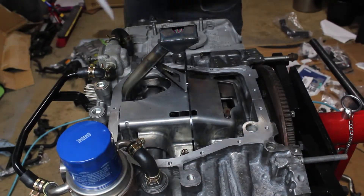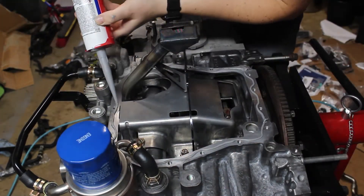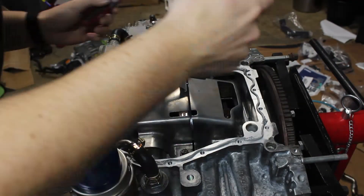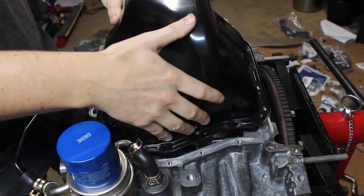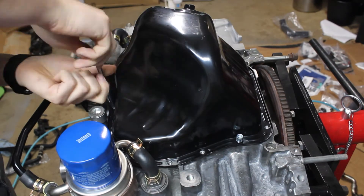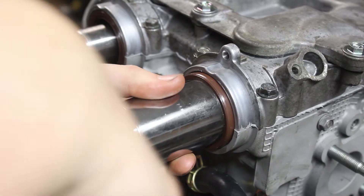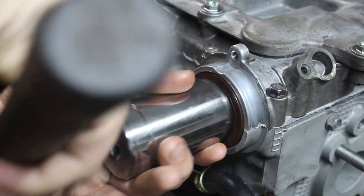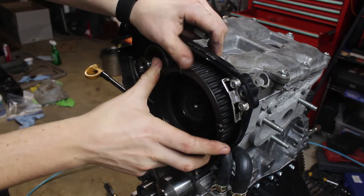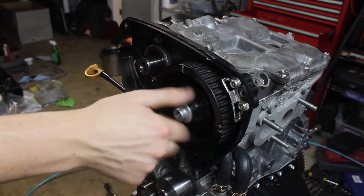My new oil pan was ready to install next. This doesn't use a gasket — rather some sealant, which is oh so fun to work with. I moved back to the cams and hammered in the seals. Then the sprockets went back on as well. I used my old timing belt and some vice grips to tighten these bolts up — they're a real pain. The same procedure as when I took them off: you basically clamp the belt around the pulley to keep it from spinning so you can turn the bolt.